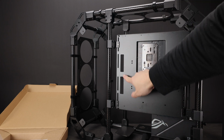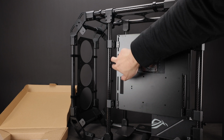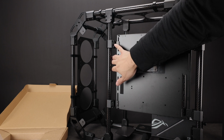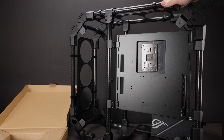These grommets are definitely for ATX. If you use EATX, they will cover the grommets, and you'll have to wrap the wires around over here. That will be a little bit difficult for EATX boards that everyone makes with 90 degrees, right? Because they have the flat 24-pin facing this way. So this is not the most EATX friendly board. Not saying you can't do it. It's just, it is what it is.